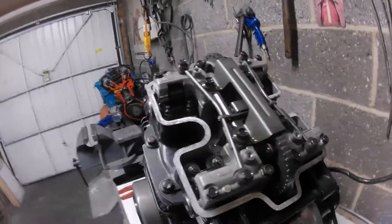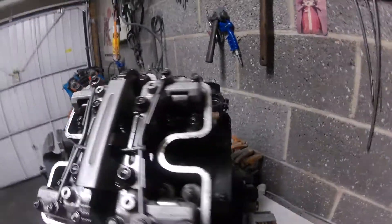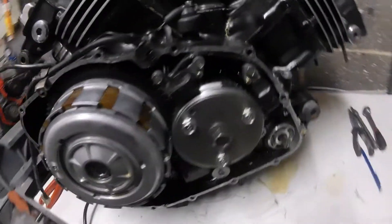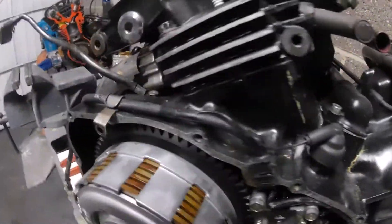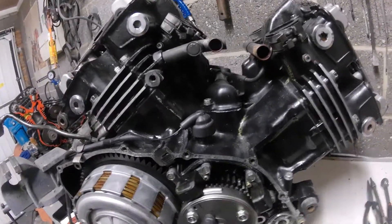The torch is dying now — I'll get that on charge. We know where we are with that: straight line all the way through, all the timing marks confirmed with tension on the chain. What I'm going to do next is get the camera mounted up, get the clutch off, primary drive off, take the ignition pickups off, starter clutch off, and have a look inside. Then we'll start stripping it down.